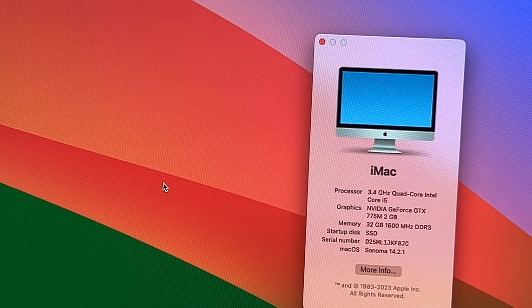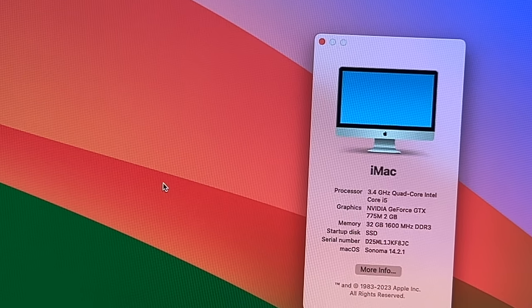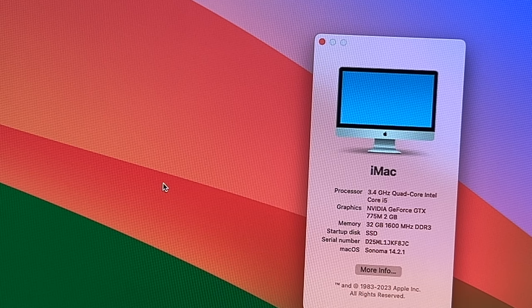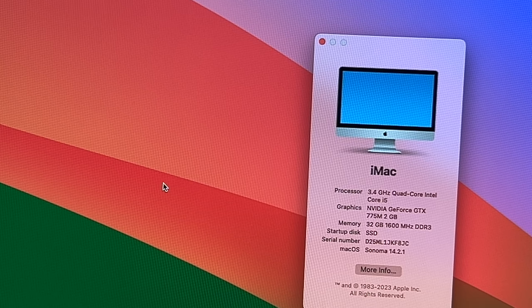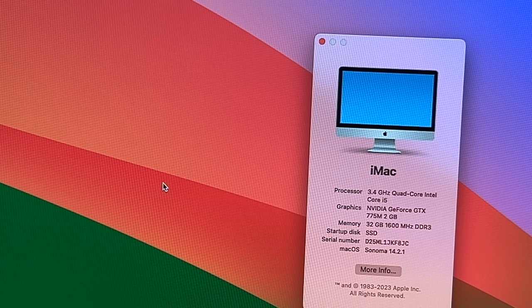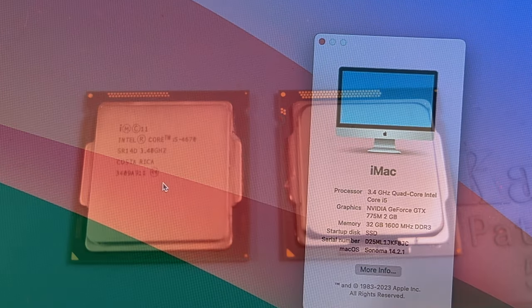So we're going to put that in here. And you notice we got all the duct tape on it there. That's holding the screen on. So what we're going to do is turn this off again, take the screen out, take it apart, pull the motherboard out of it, and replace it with the i7 processor. Of course, I have to repaste it again, and we'll get it back in there. So then this will be an i7, hopefully. He says it does work. It's been tested, so we'll see. But it works beautifully. I've put some of the software that I have on this, and this is what I'm going to be streaming off of all the time, and that'll stay out here in the garage. So anyway, I'll be back in a bit.